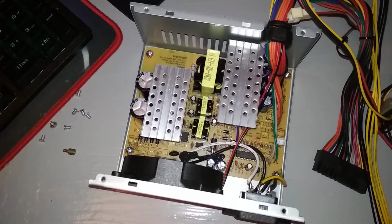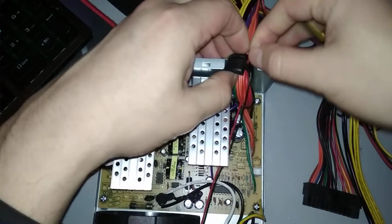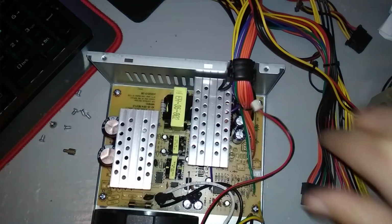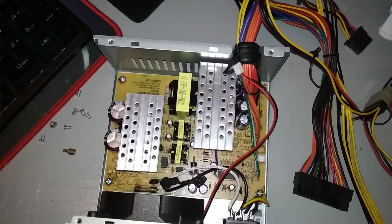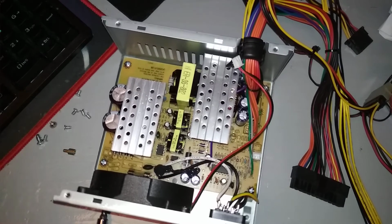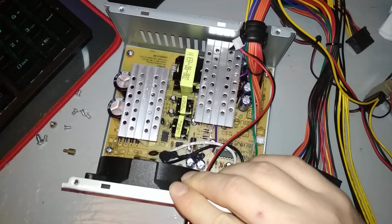So let's see. Let's get out the fan, which was connected to 7 volts temporarily through this hole. When it's connected normally, it's connected to the main board here, and it's 12 volts, and it's the loudest thing in the house. So yeah, I couldn't stand that. So let's see. Unmount the fan. The screws fall down exactly as I planned. Two, perfect. That's how I wanted it.